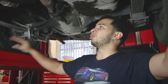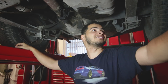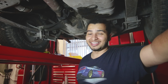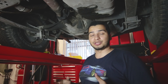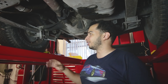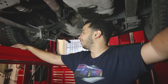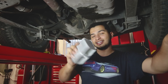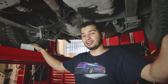Underneath the car it actually doesn't look too bad — everything is relatively rust-free and oil-free, other than the diff. We're modifying this mono leaf spring. There should be more leaf springs because there are four spacers the size of leaf springs. What I think happened is Ford had a set height for these Explorers, but since the weights were so different between models — four-wheel drive versus two-door — this being the lightest, they just put four spacers with one leaf spring to cut costs. We're going to use three-inch universal spacers on top of the leaf spring between the axle.